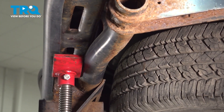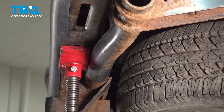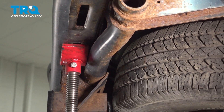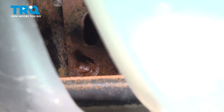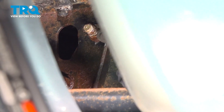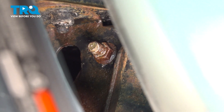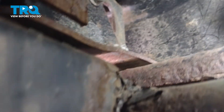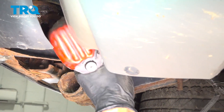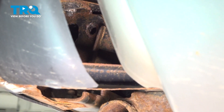Let's use something underneath the bumper to hold it in place while we continue on along each corner of the vehicle. Now pay attention along the corner of the bumper — you're going to find a bracket that holds the bumper to the frame. In this area, you'll find two 17 millimeter headed bolts that come through the frame from the inside out towards this bracket, held in place with a 17 millimeter nut. Hold the bolt head with a 17 wrench, remove the mounting nut, then remove that mounting bolt.